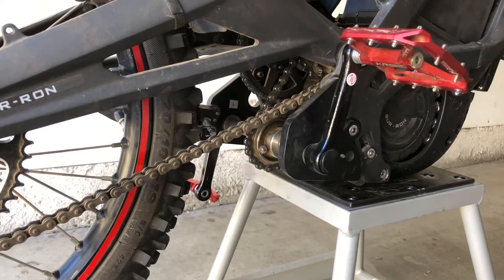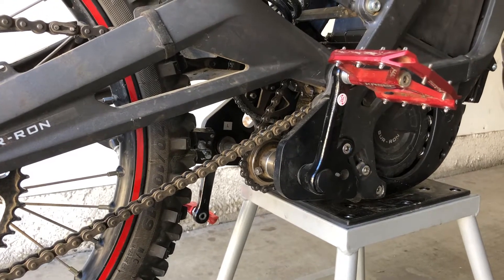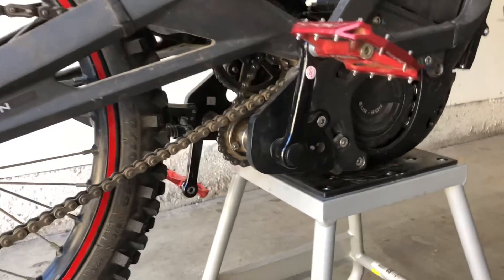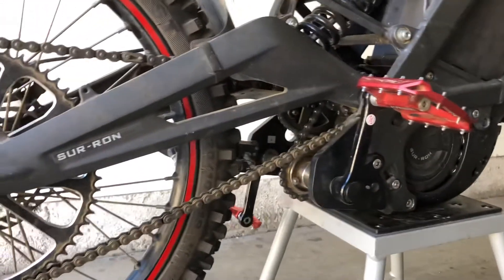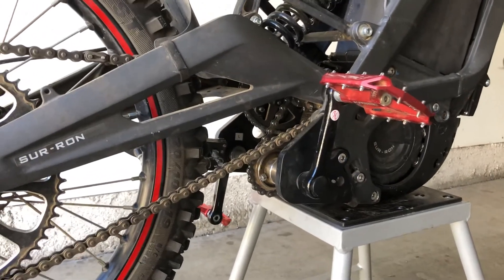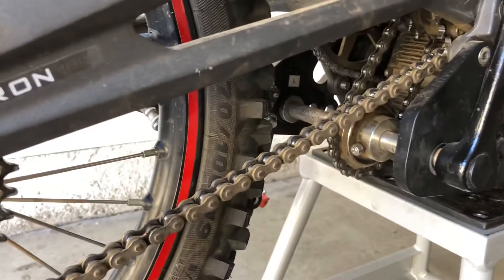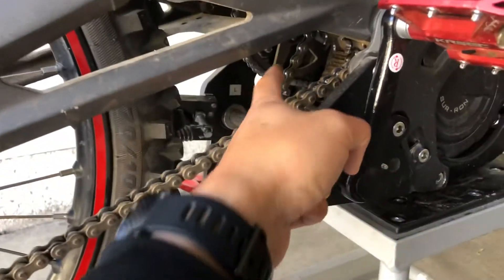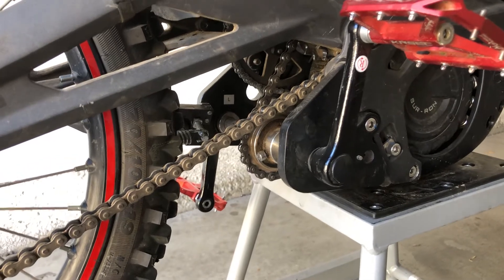In terms of what Kaniwaba could do to make it better — it's difficult to say. It would be cool if they had a little template bushing or jig that would space both sprockets more precisely lined up, but the jackshafts on different years are different so I don't think that would work universally. People suggest putting a chain tensioner on there, and I suppose you could — maybe mount something on that little spring-loaded tab on the swingarm, run a half link or a different size sprocket so there's more variable tension on the chain and people won't have issues with chain bind and breakage.